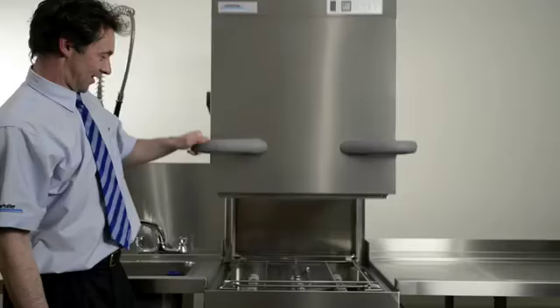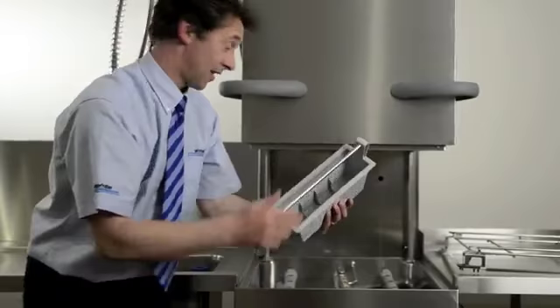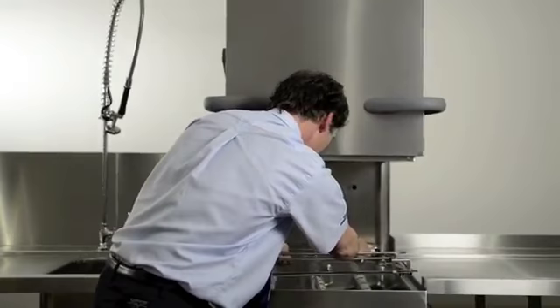Through the day cleaning. Lift the hood and remove the basket cradle. Remove and clean the filter basket. Replace the basket cradle and close the hood. The whole process can be completed without draining the machine.